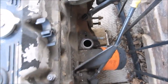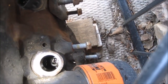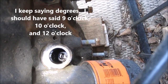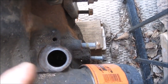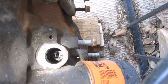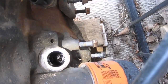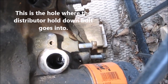The next step, once you have the distributor lined up with the pin, you have to get your oil pump slot lined up in the right place. If you look, you can see it's not quite at 9 o'clock and not quite at 12 o'clock — it's kind of between, like 9.5, right in this range in between. The whole idea is when you slide in the distributor, you want that little screw hole to be right in the very center of the teeth of the distributor.